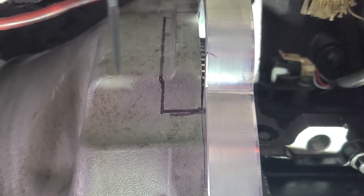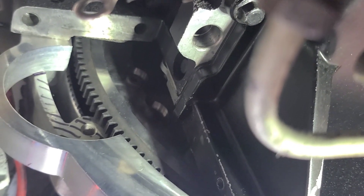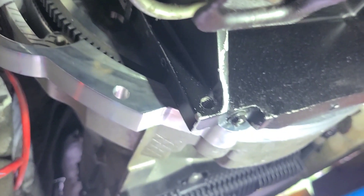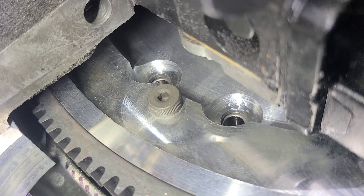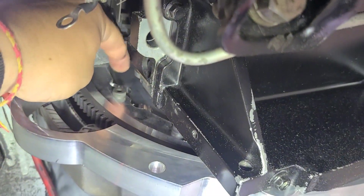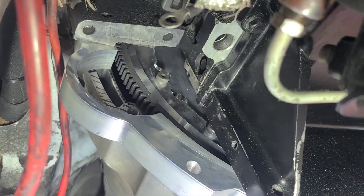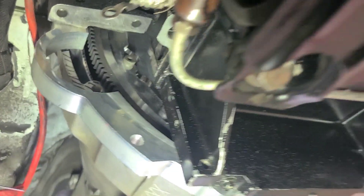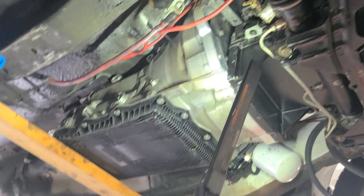Where those sharpie marks are I've got to go that deep in that area and grind all that back just so the starter snout can fit in there. Another real challenge is going to be getting a socket and wrench to the converter bolt holes — these are two of the converter holes right here, and there are four more evenly spaced around. The ability to get a wrench in here is going to be tough because of the angle. It's not going to be terrible, just not as easy as it was with the 4L80. The reason I'm not putting my trans-crossmember on is I've got to take it all back out so I can cut that out, and then put it all back in.